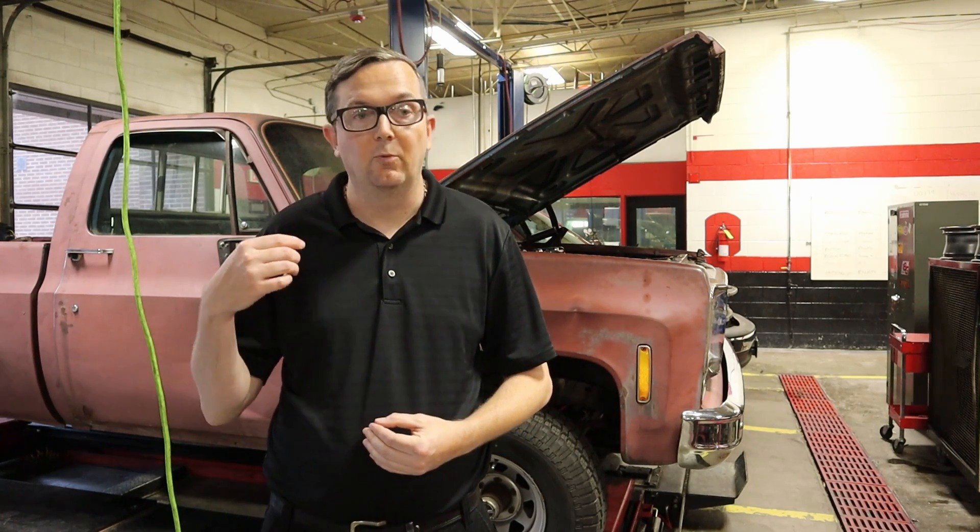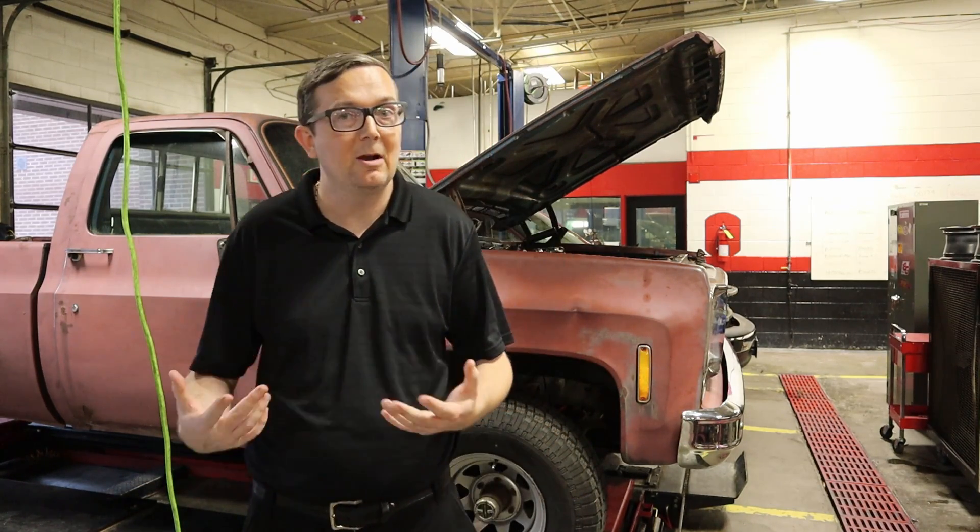Really quick, really easy way — thermal camera on this. If you have an infrared reader, you just want to run it down the manifold tubes or the header tubes like on this car, and the cooler one is going to be the one that's not lighting off. It's a real big indication that you don't have something right in that cylinder. We don't have codes on this car. We don't have a check engine light. We don't have anything telling us something is wrong. But normally the customer will say, hey, my car's not running right. Old school — this is the way we new school check the old school cars.